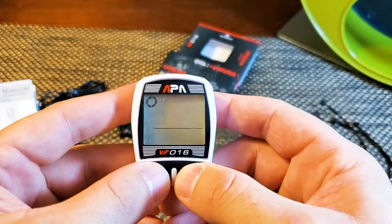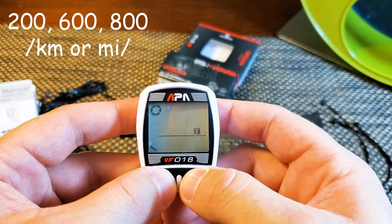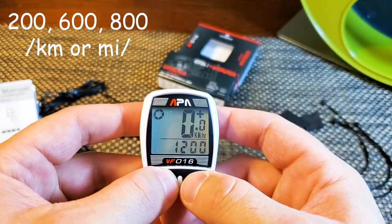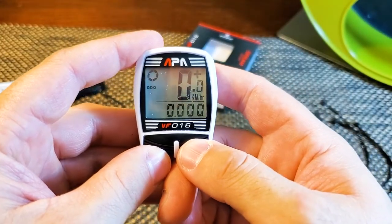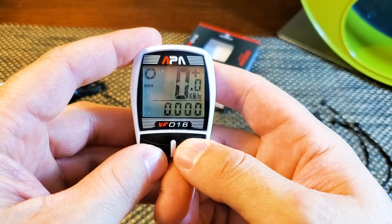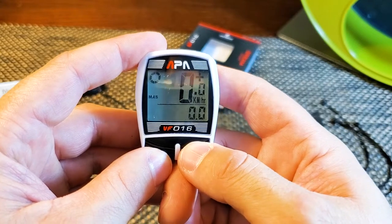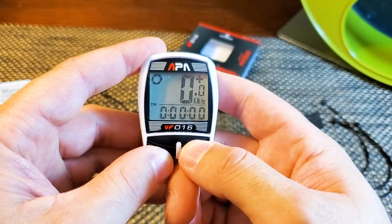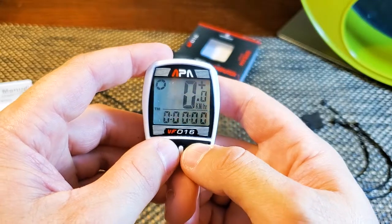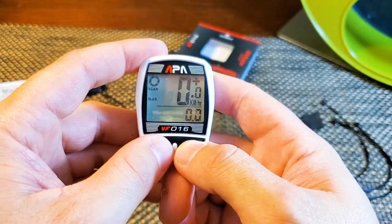Next, on the screen you can choose between kilometers and miles. The next setting is for your maintenance program — it's used to remind you for parts replacement or to lubricate the chains and wheels after the desired distance is reached. Once you set everything, on the top of the screen you can see your current speed. By pressing the right button you can cycle through: odometer (your total distance), distance meter, maximum and average speed, the time (which records only time spent actually moving), and the last one is temperature. Or you can leave it on scan — the computer will cycle between all of these automatically.